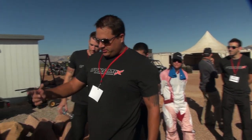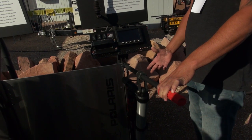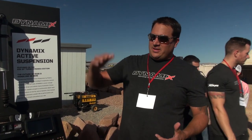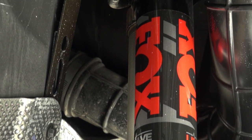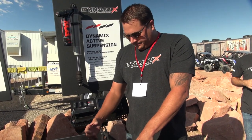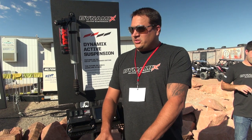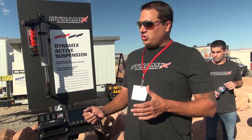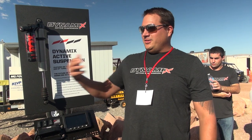This is the shock — Fox did this design, completely. It's 95% a conventional Fox shock: same body, a piston with valve stacks. You can take these apart, rebuild them, change the valving if you want — make the whole system a little stiffer or softer — and the dynamic system still works. The real change is they took the clicker valve assembly out and put in this valve. It's more than just a low-speed or high-speed clicker — it adjusts both. It's changing just compression damping, but it's a huge range — about double what the Fox bypass or Walker Evans shock offers. Because it's electronic and we control what it's doing and when, we can make the shock softer than it's ever been and stiffer than it's ever been, because it's not purely in the user's control and we can keep it safe.